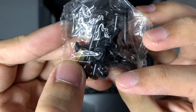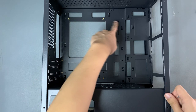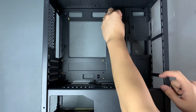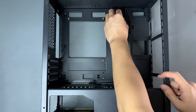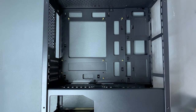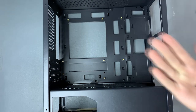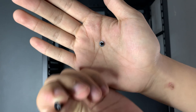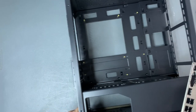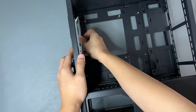These are the screws, and we're going to need these gold screws called standoffs where the motherboard screws will be screwed into. The pre-installed standoffs are not enough for our motherboard, so we need to screw in two extra standoffs in the case. First hand-tighten them and then tighten more with a long nose. Next, find the right screws in the provided screw bag. Now we're going to install the IO shield first into the case — this is a very important part, so do this first.